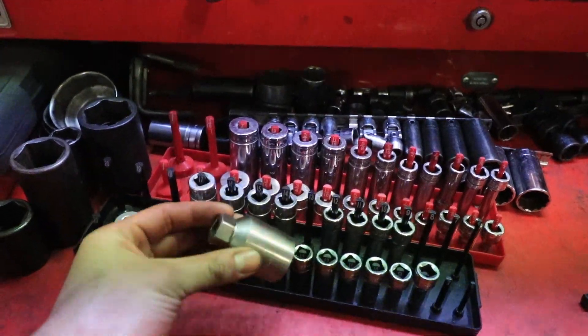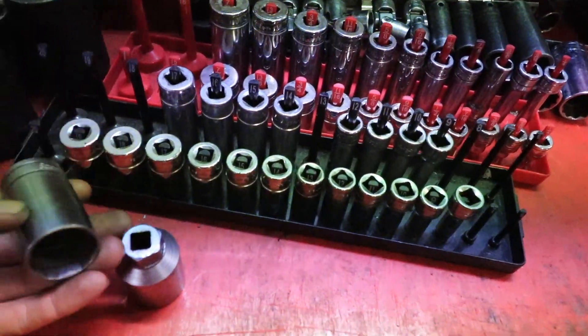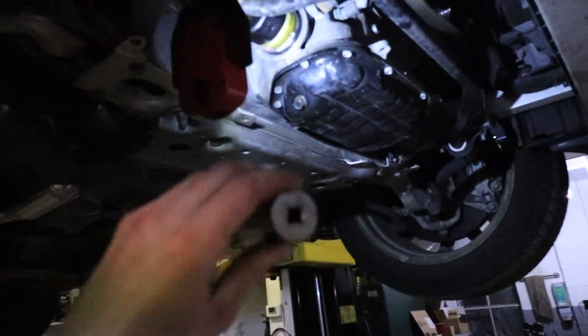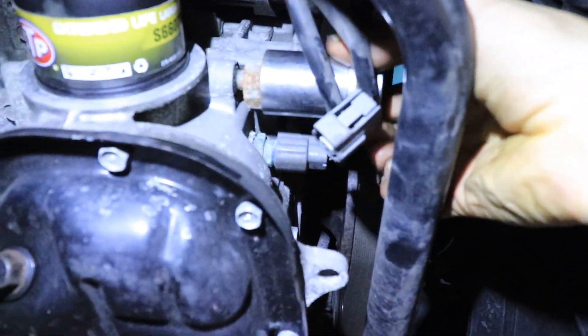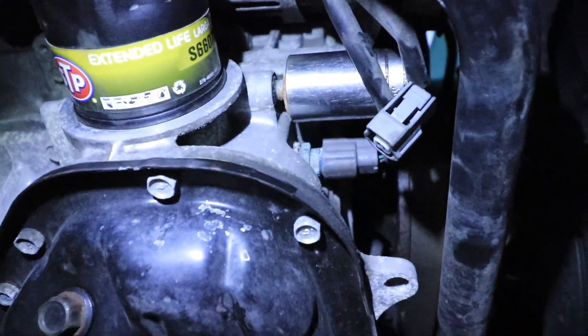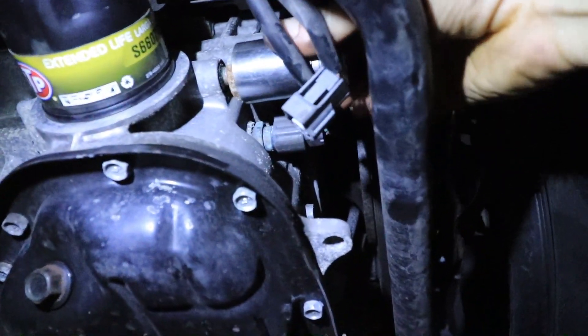I have two styles of this socket — this one's a shorter one and this one has a wider back. Because sometimes with the plug on it, you can't actually fit the socket on. That was the problem we were having with the other one — it only went on about this far. So we're using this one so it seats in fully and properly. I'll put a link in the description below; they're probably not too much money on Amazon.